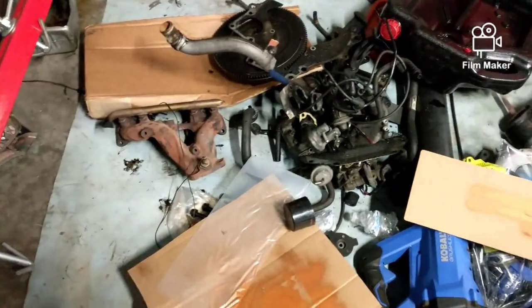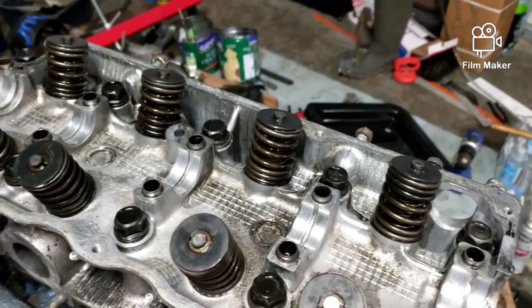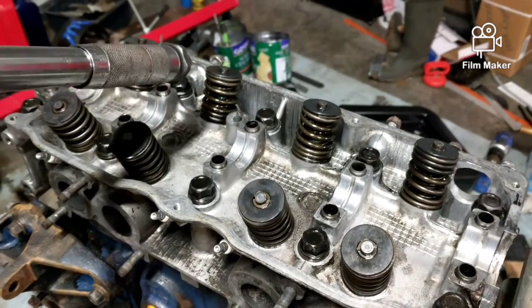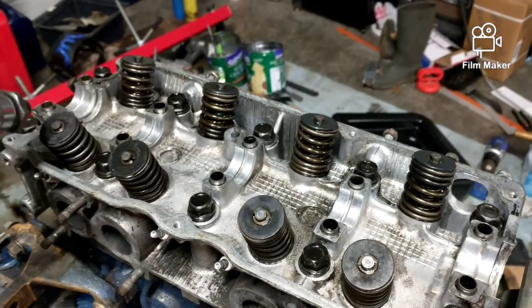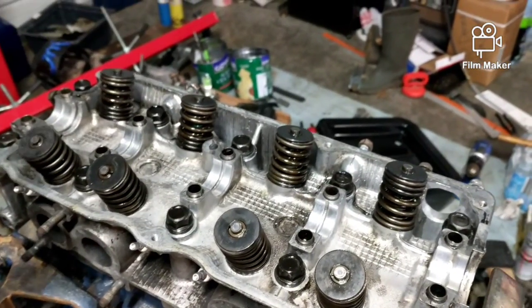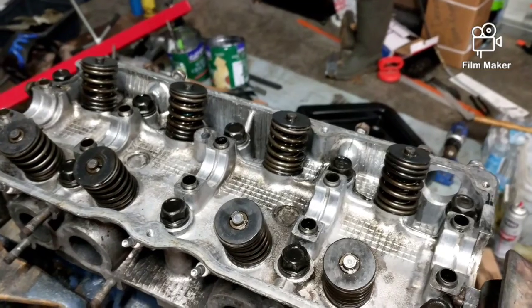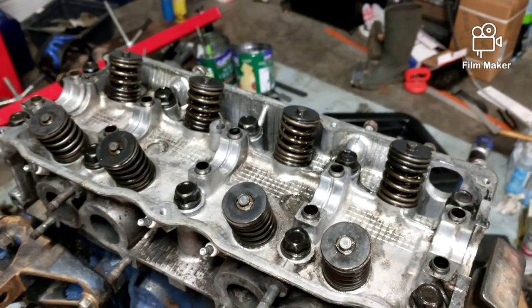All right, got all the bolts down to about 18 pounds, starting as usual, 1, 2, 3, 4, 5, 6, 7, 8, 9, and 10 over there. Now I just checked the book again. It said go 59, then 64. So I'll do 59, the same sequence, and then 64.